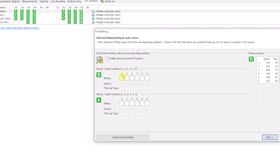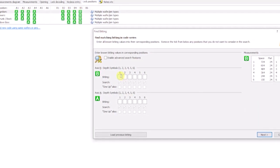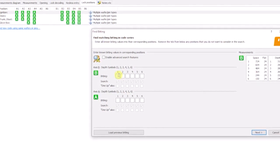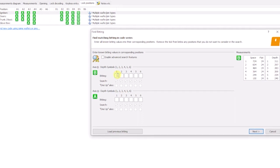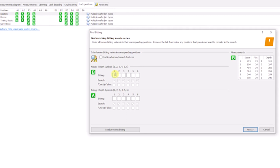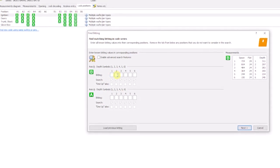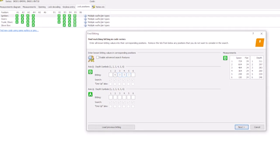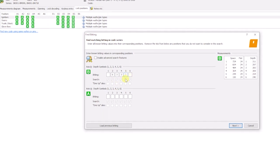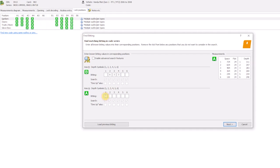And I think I read that the Lishi inverts the data, so I'm not sure if that's 100% or not. So I'll enter the A track information into the B and see if that brings up a valid key code. And we didn't need anything on one. We had a 633, and then it said number 5. They gave that B number on there, so that may not be a valid code either.